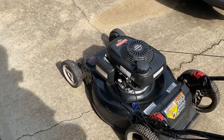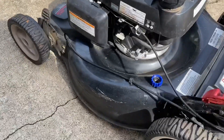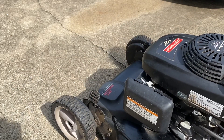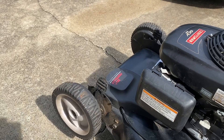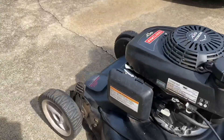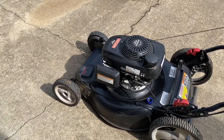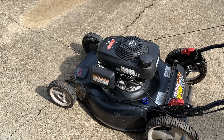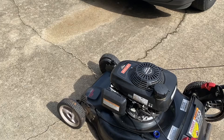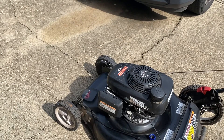Here's your final look and start. It runs real good now and the front wheels work — they're not bent in like they were before. To recap what I did: cleaned out the carburetor, added new fuel line because it was cracked, sharpened the blade, topped off the oil, the air filter was good, and I added two new wheel bearings to the front wheels. The front axle adjuster probably should be replaced on one side but it'll work fine. See you later.